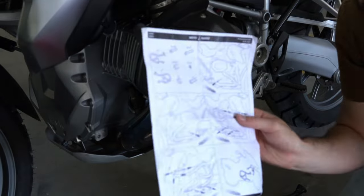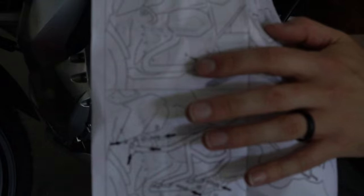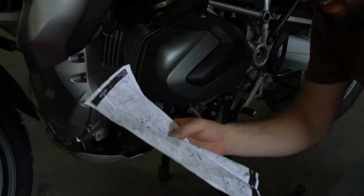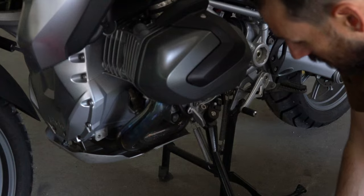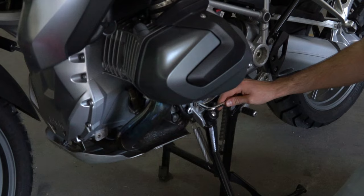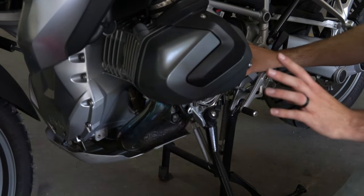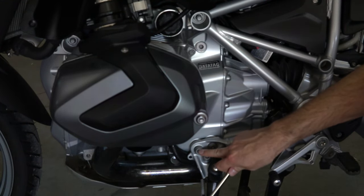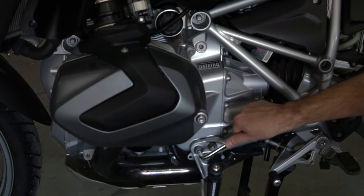The instructions are a little bit garbage — they kind of just have a blank space where the bolt comes out. But I know which bolt needs to come out. This is a T-50; that's the size that's coming out right here. It is the second bolt — there are three bolts right above the kickstand. Let me get you a better view. Yeah, so it's this bolt right here that's coming out. That's a T-50, that's what's taking this out.